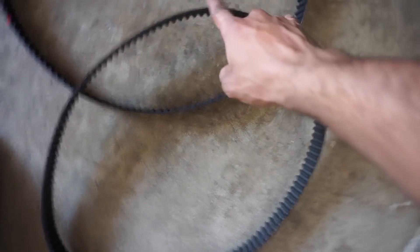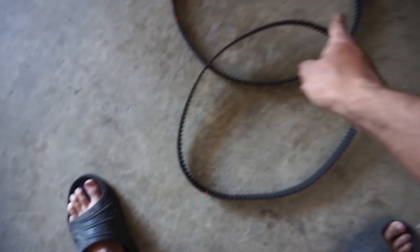The next step is the new belt. Make sure you've got it oriented correctly — top marked at the top — and then count the right direction, physically counting the teeth between marks: 13 up between the top, then 46 or whatever it is. It'll be different depending on where you put your marks, but make sure to count every tooth between everything.